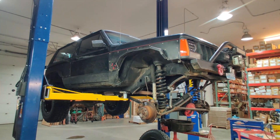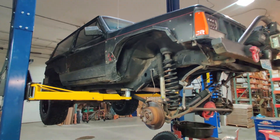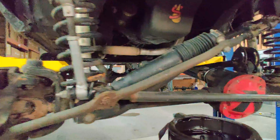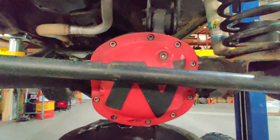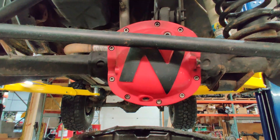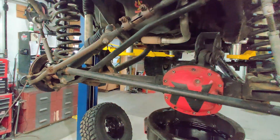Let's talk about how to do a front axle kit. Today we've got on the rack my 96 Jeep Cherokee XJ 2-door that I've been working on. It started out as a junkyard project and now it's wearing all sorts of fancy stuff. My favorite mod so far has been the re-gear — we went to 4.88 Nitro gears from stock 3.07 gears, which made a night and day difference in available power, torque, and gas mileage.